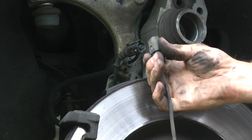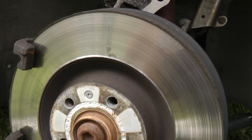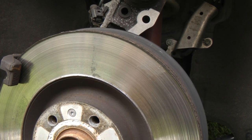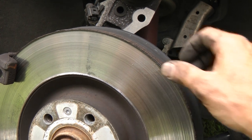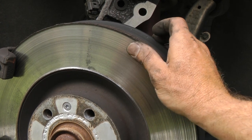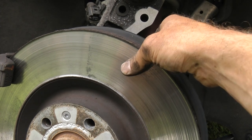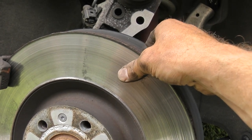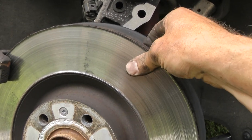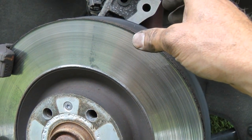That did in fact go way better than the first time, but I wasn't sure what I was doing. Now this is just me as a novice and probably the most controversial thing I'm going to do here. If you look at this lip, I don't even think it's a millimeter difference between where the pads are touching and where they weren't touching. You've got maybe a millimeter or a millimeter and a half less thickness of this entire disc after 55,000 miles. I can't imagine that is going to make any difference.